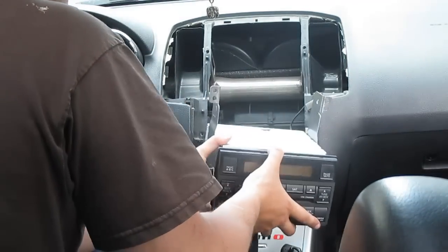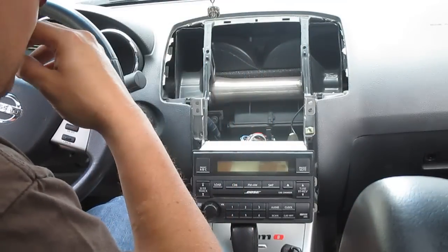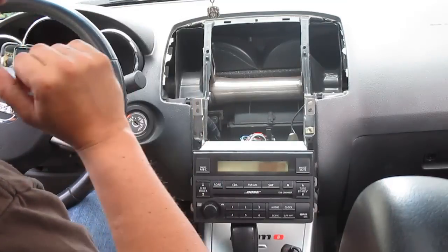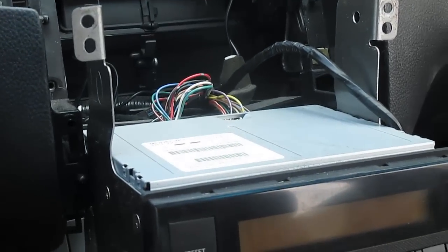Alright, same screwdriver - one on either side and one on the back - and this unit's gonna come right out. Everything's unscrewed, pull it out nice and straight and set it on the gear shifter. I stuck my iSimple unit down here just underneath that wiring harness. I do have two auxiliary ports but I'm only going to run one set - you'll have an AV and an auxiliary port off port one, and an AV and auxiliary off port two. I ran the AV cables from port one down into this box for easy access, and the iPod cable runs down by my feet so it'll reach anywhere in the car.